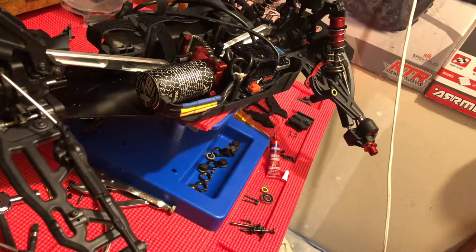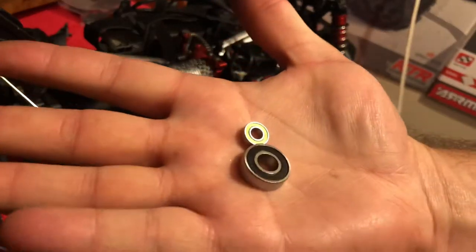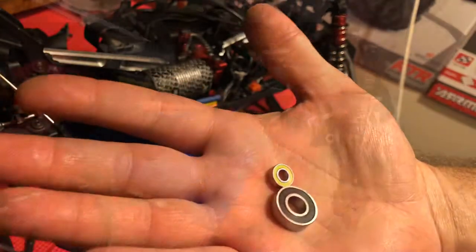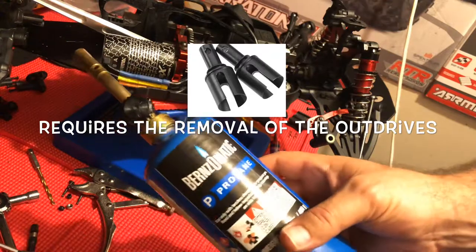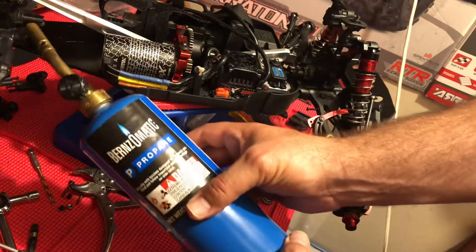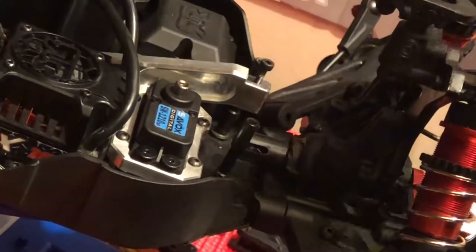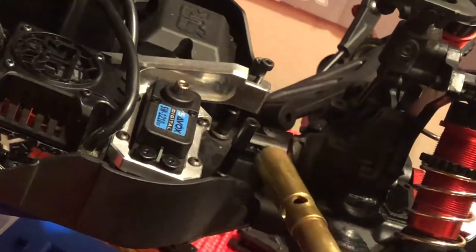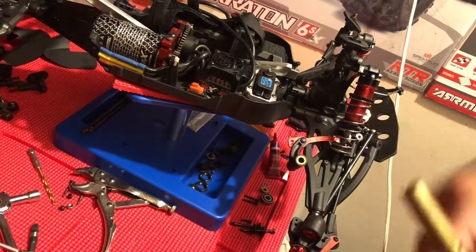And these are all rubber sealed bearings. So to get those new Avid bearings in, I had to take the torch to it, and it wasn't as difficult to do on the back end because it's open more, and with some care you can heat that up without worrying about damaging the plastics. The problem is on the front end, there's not as much room, and I'm not all that comfortable heating that piece up with the fear of melting anything in there. So I have an idea.